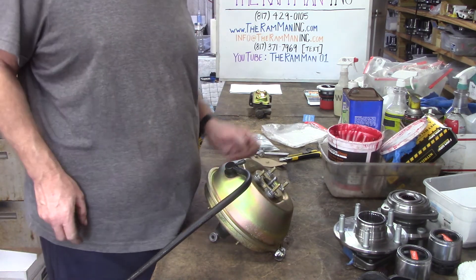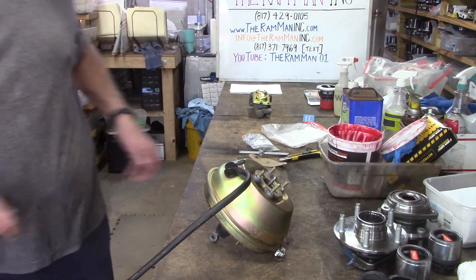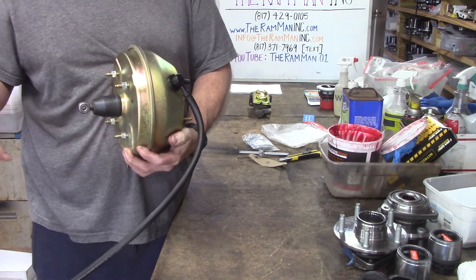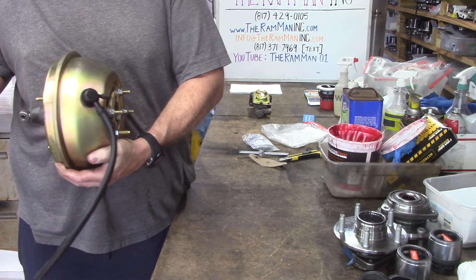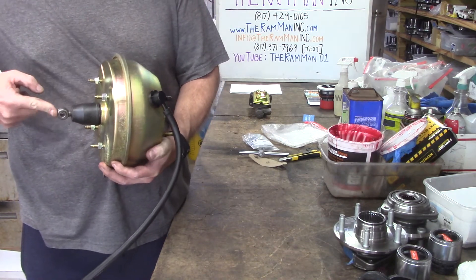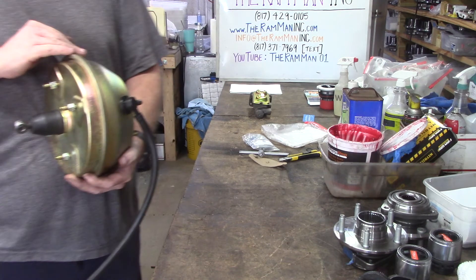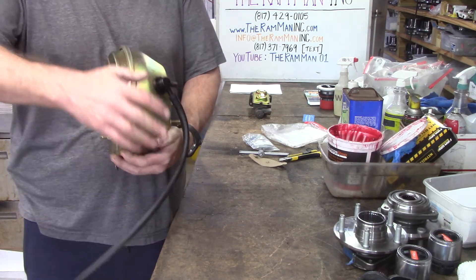I'm doing this field test — of course he's already been tested. There's the action: it's very smooth. I can do it with the palm of my hand. You can see the master cylinder push rod — it's extremely smooth. I can actually take one finger and operate it because I'm under vacuum. It rebounds all the way and it doesn't self-apply.